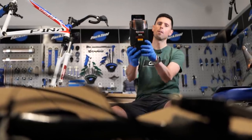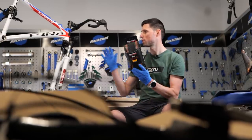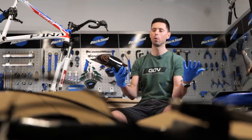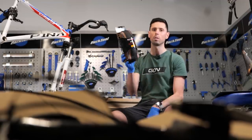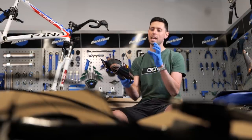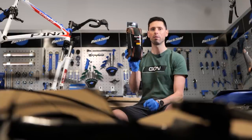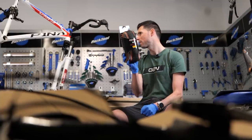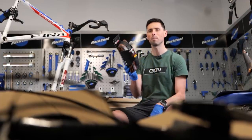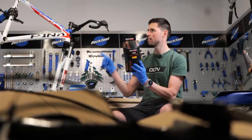Tires next. Because I've chosen to go down the 650b wheel set route with this bike — due to all sorts of issues with spacing and the fact it had smaller wheels originally — I've gone for a 650b tire, and I've gone for a 45-millimeter width. The advantage of using that slightly smaller wheel size is that it allows you to run a larger volume tire. Hopefully the 45-millimeter wide tire will fit and we'll have clearance for it. I've done a bit of rough estimation and I think we should be all right. Let's get these onto the wheels.